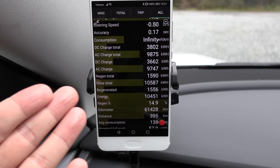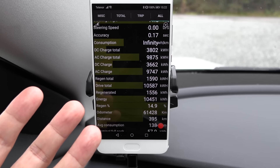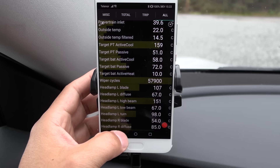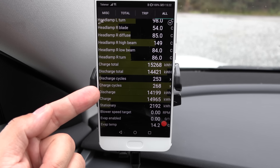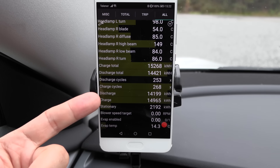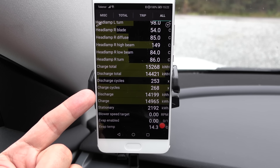Some people say that's how Tesla hides consumption — that they're lying. No, this is most likely the stationary consumption, because the owner has sentry mode on. You burn a little electricity but get a dashcam when stationary, plus some vampire drain. Further down there's another variable I want to show: number of cycles. I'm not sure what this is — it's probably calculated internally. The developer likely looks at how many kilowatt hours were charged and divides by around 50 kilowatt hour. This gives 268 cycles, which corresponds — 268 times 50 is around 13.5 megawatt hour. So it makes sense.